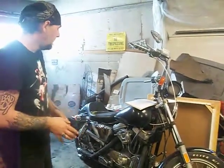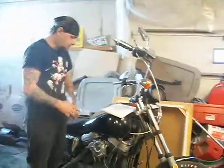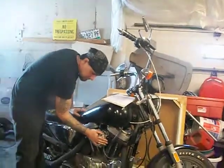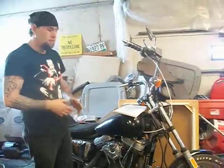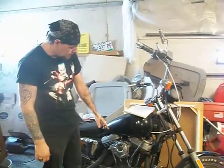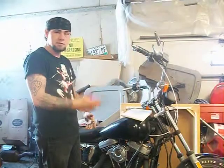The carburetor took some time. I noticed when I first put the carburetor back on the bike that I wasn't getting fuel into it because the float bowl was empty. So I did what I call priming the carburetor — I took my hand, placed it over the air intake and over the choke, and turned it over a couple times. When you feel the gas hit the palm of your hand, you know the carburetor is primed. Then it's just a matter of fiddling with your idle fuel, air mixture, and choke to get it running.